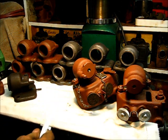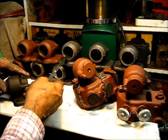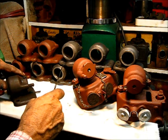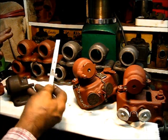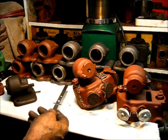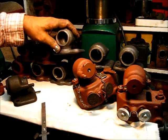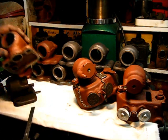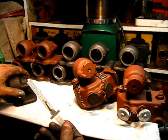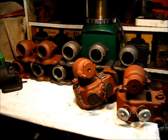This right here — what we just did, this little series — this is the reason that you have to run a closed or partly closed choke. It's part of the reason you have to do that, because the compensator does not operate if that seat in there is eroded away. It's one of the most important repairs that you can do to a McCormick Deering Type M. It's highly important.